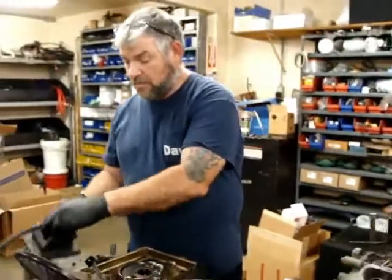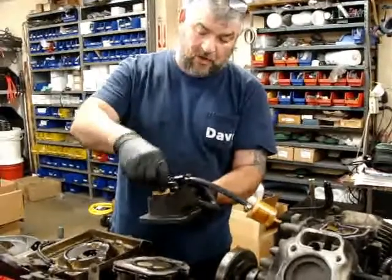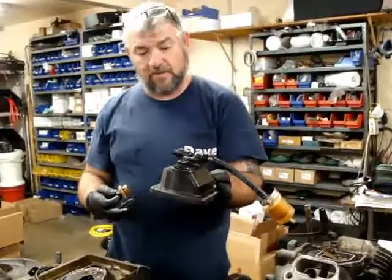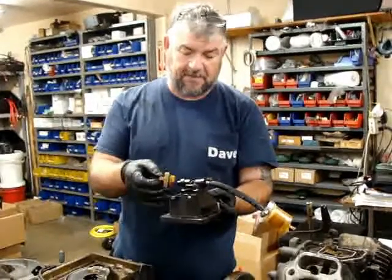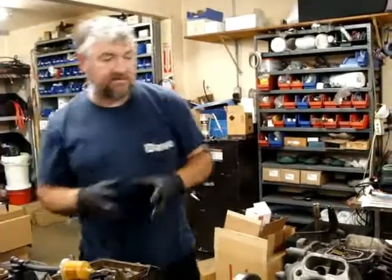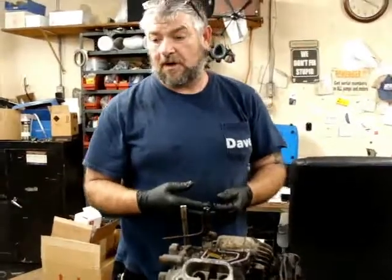But the number one thing it does is guys come in with their valve cover oil cap and it just turns, because the pressure inside the case has blown out the threads. When you do that, you have to replace the whole assembly. There's no fixing it. But I see guys wrap plastic bags and push it in and try to wedge it in place. It doesn't do any good. The best maintenance in that aspect is the preventive maintenance of doing it right.